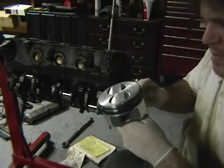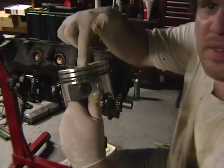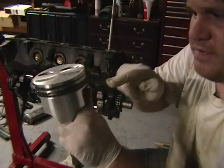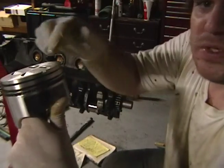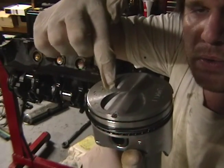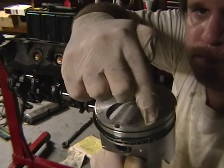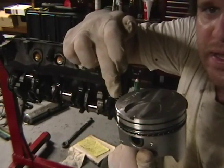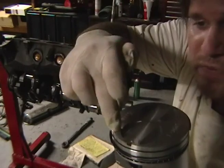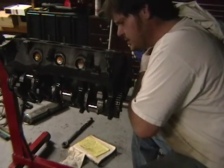The oil gap rings are centered up with the arrow here and they're about 45 degrees off from that center line, so if that's center you've got a gap here and a gap here. The top ring is here and the second ring is over here - the lower ring. Let me do a quick cleanup inside just to make sure there's nothing in there.